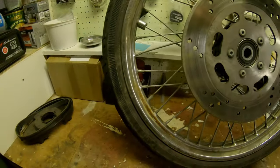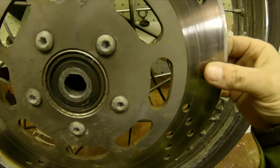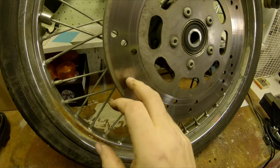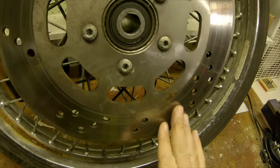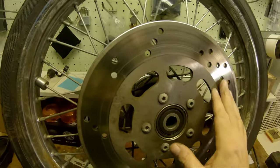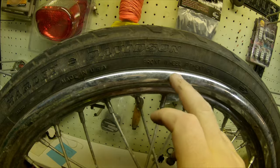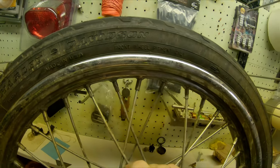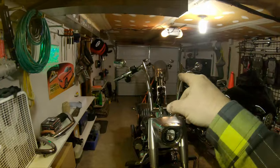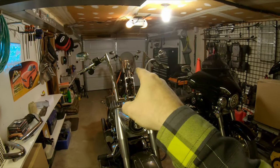Flip that over — everything here looks good. I don't feel any major ridges front or rear, I don't feel any deep grooves. I think the rotor is in good shape. I don't have any micrometers to actually measure it, but I'm going to run it because I haven't noticed anything yet riding it — though I'm probably going to need to do some new brake pads. They are still Harley wheels, so at least I know they're not original to the bike. But they're probably only the second set of tires this bike has ever seen, which is a little scary. So gonna get back over and get that rear tire off — wash, rinse, repeat.